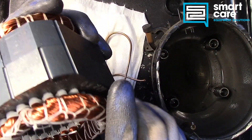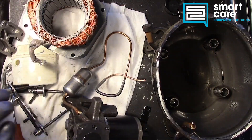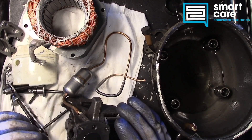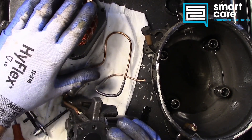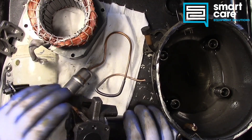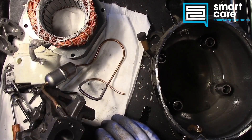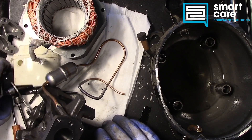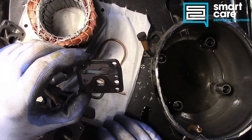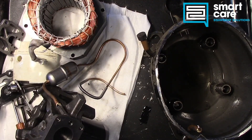On our motor side, you can see the internal connection for our common, start, and run going to the windings of the motor. There's no internal thermal protection — the electrical thermal protection is on the outside. As far as the principles we're using in this object: we're running a motor, dealing with electromagnetic fields, taking that rotary motion and turning it into pumping motion. The valve plate is really the core of this system — being able to control that vapor as it's pulled in and then pushed back out under pressure. What we're doing is adding energy to the system.